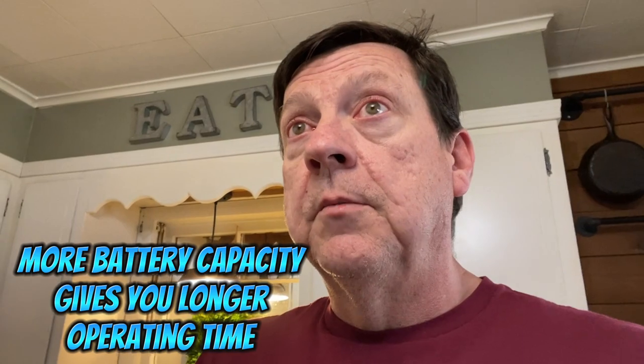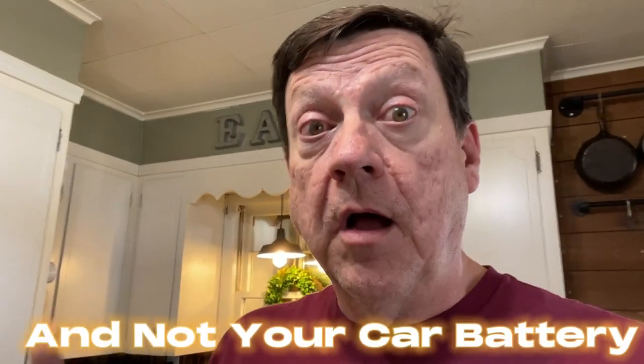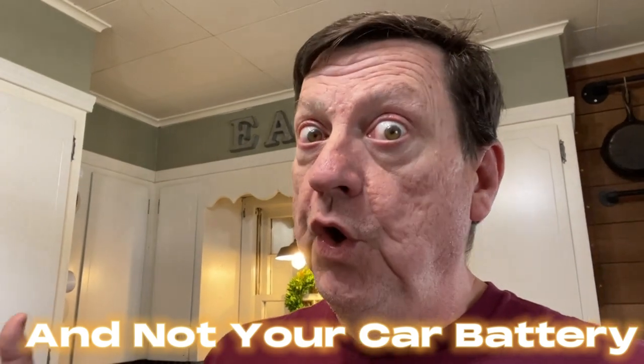I only have a 10 amp-hour LiPo battery back there — it's a cheap one I used to test. I would put as big a battery as you could fit into that back seat, or in a trunk if you have one. As you're driving along with the relay switch on, your charger is charging your battery. So when you get to a campsite, a POTA site, or whatever situation, you can let the whole operation run off that battery for a good long time. Jason KC5HWB runs a 100 amp-hour battery in his truck — by all means, more capacity is better.